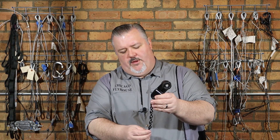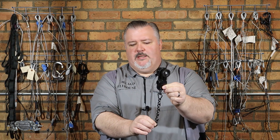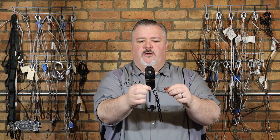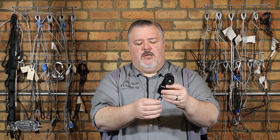To test these, we decided we would do a couple different pulls. First, we thought we'd pull on the end of the chain and see what that did. We expected that the chain link would open when we did that. Then, once we pulled the wire out, we thought we'd try the actual base of the carrier itself and pulled on that hole. You'll see in the testing videos that the chain comes off predictably easily — it's not too hard to pull that chain out of there. So for the rest of the tests, we didn't bother pulling on the chain because it's the same chain on all the carriers.